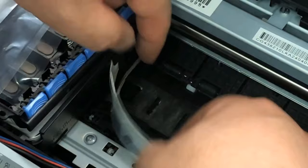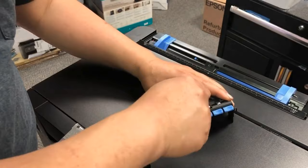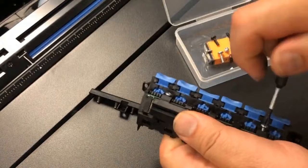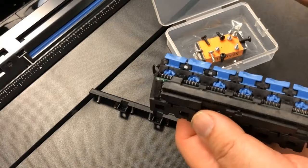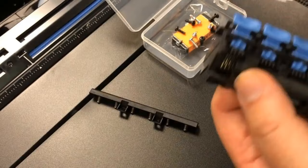You might want to bookmark this video and come back in a couple of weeks. Now, when you detach the cable and take out this assembly, there are four screws — we're going to take off the middle two and then remove this guard. There are springs attached to the guard, so be careful. Remove the two outside screws and we're ready to take this cover off. This is the PCB board. Now we do the reverse: put this guard back and put the two outside screws back.